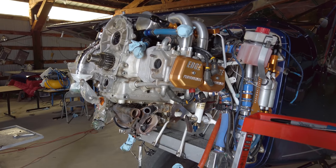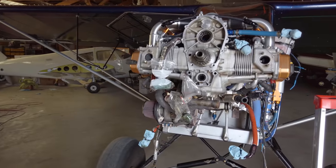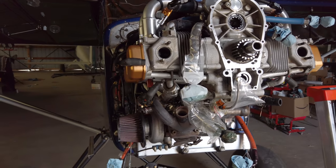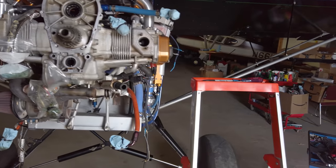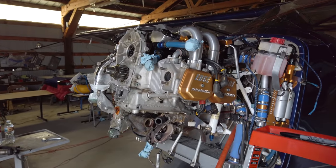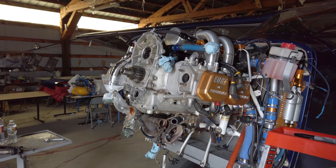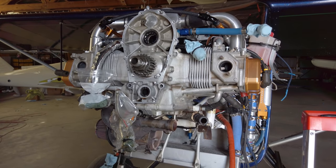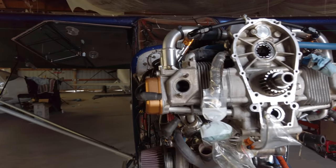I also want to mention, since we're stopped and talking about things along these lines, I've just been working with Thomas and Jason both regarding what I'm going to do here, and they have been absolutely phenomenal in moving quickly to come up with a solution, to get parts, to trade back some of the good parts off this engine, and working deals and just reaching out and finding the parts I need. And at this point, nothing's for sure here, but I might be not only doing a new heavy duty through bolt case with a welded crank and a bigger aftermarket turbo cam, that's for sure, but I might be working a deal to get some new ULS cylinders and their shims.